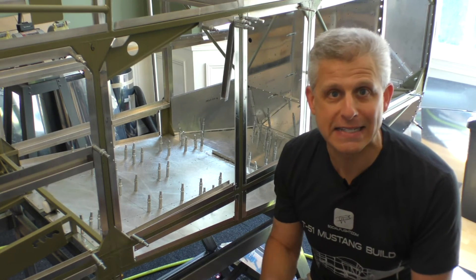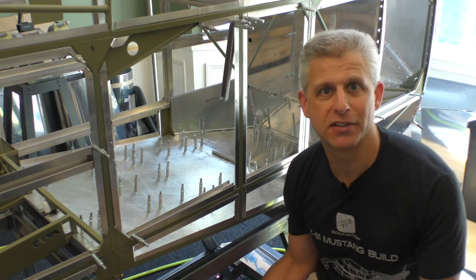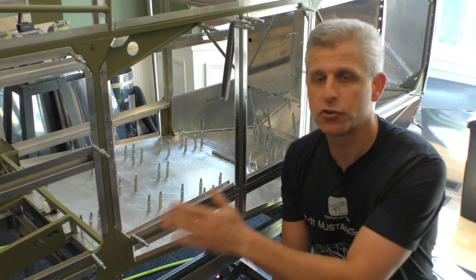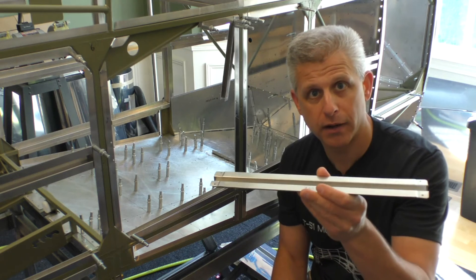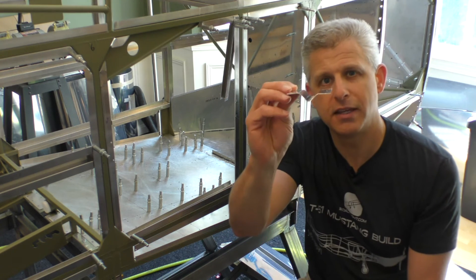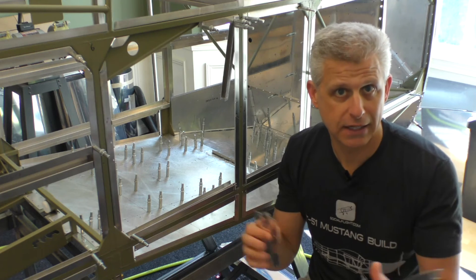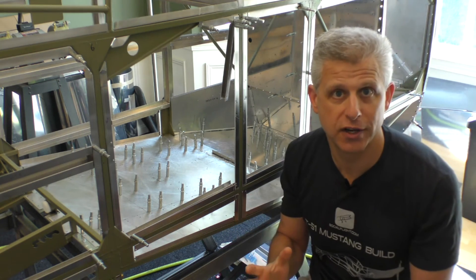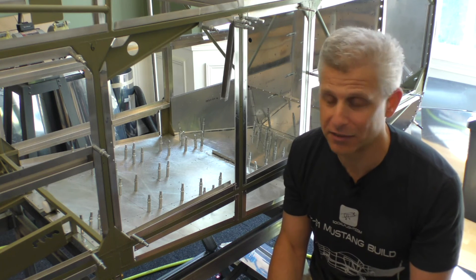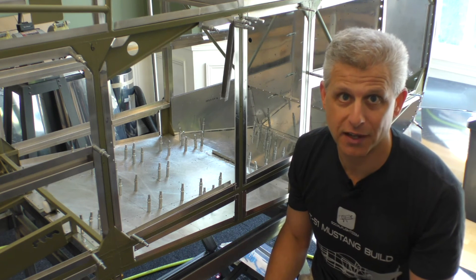We're at the end of another phase of our Titan T51 Mustang build — we finished the cockpit floor. It all started with flexible aluminum with no structural integrity. We used hat sections on areas with structural members from the frame, sandwiching from the bottom, drilling and putting clecos in place. In areas without a structural member, we used V-channel structural supports for additional stiffening underneath. By clecoíng and riveting everything into place, we ended up with a rock-solid structure. We've stood on it ourselves and it doesn't move, even with only a few clecos in.